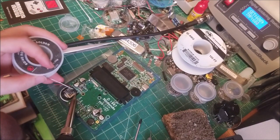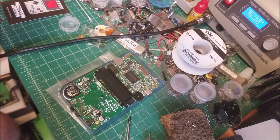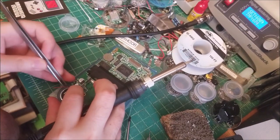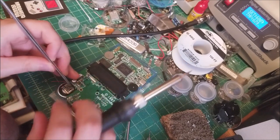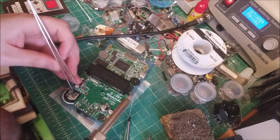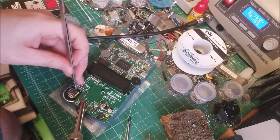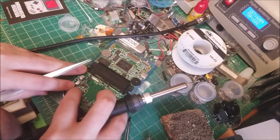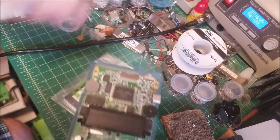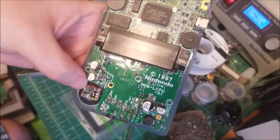I'm going to place this board back in, making sure the wires don't pinch for the speaker — tweezers will definitely help. I guess the speaker wire should be soldered first. Just going to tin the top two pads. I don't think the orientation matters because the speaker, even though it is sort of polarized, it sort of isn't — so it's not really super important whether the black or the red goes on top. This isn't stereo, so polarity doesn't critically matter here. The speaker wires are done now.